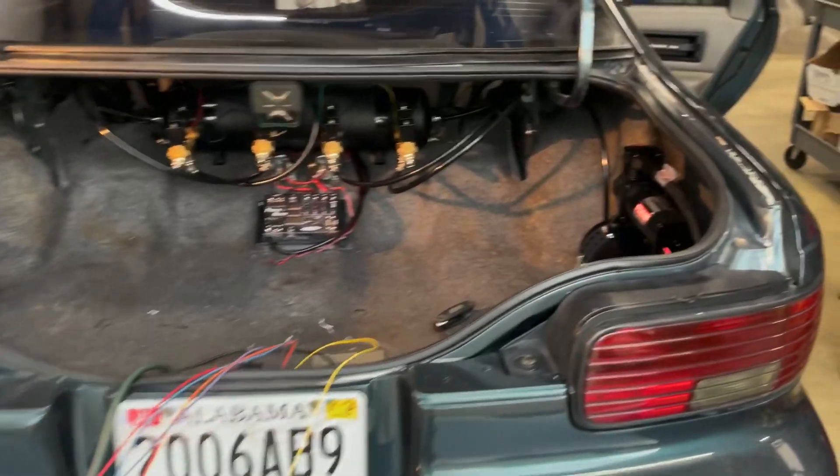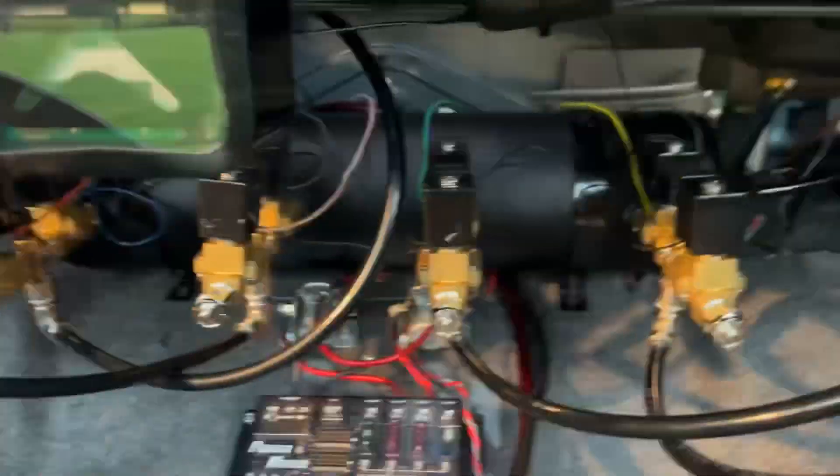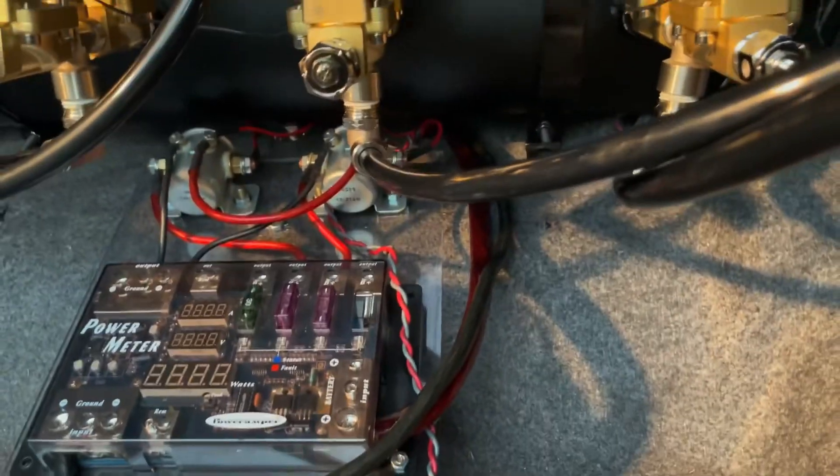I got all my existing wires re-ran and sorted. I'll leave these loose for now because some wires are gonna come off the controller and tie in at the same spot. Now I'm about to wire the controller up. I got a ground wire, a remote wire, and a main hot wire, plus some wires going to the compressor relay. I think I'm gonna just stay with my old wire for the compressor — coming off the hot going to my pressure switch, then from the pressure switch going to my relay.